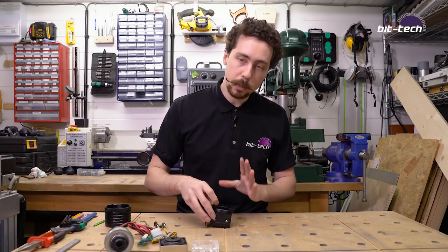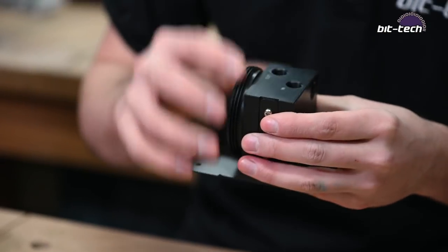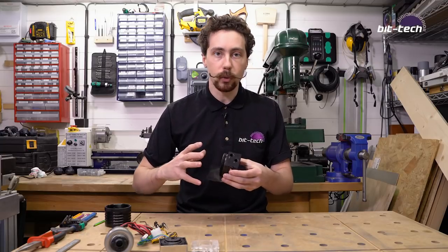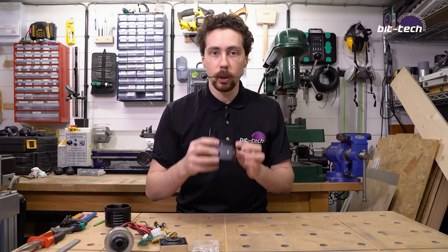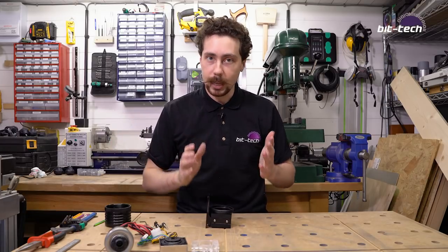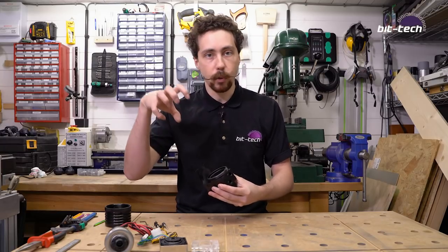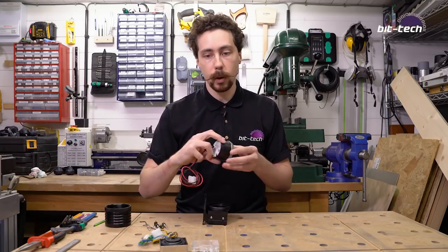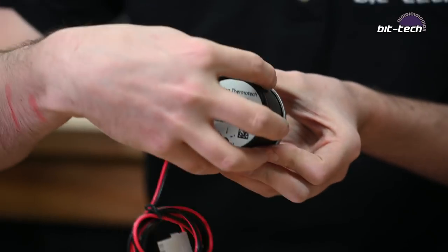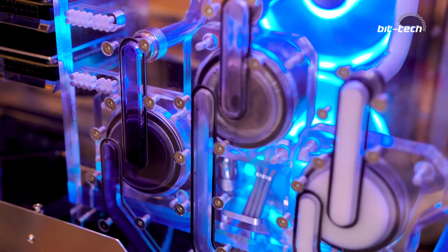The D5 is a little bit bigger so you've got more consideration about the area it's going to take up, and a lot of them use screw retention fashions which are difficult to machine — they're normally turned or thread milled on a larger vertical machine. If you're using a router, the way I do it is instead of using a screw mount I make a bracket out of acrylic or aluminium that just screws in the same way as the DDC — it just goes around the pump. This is what I did in the 1000D project where I've got three different brackets that go around the pumps and screw in from the back.